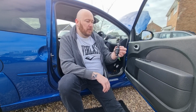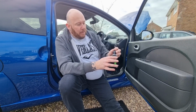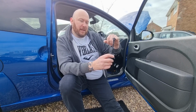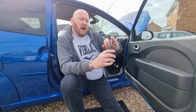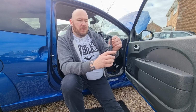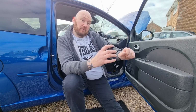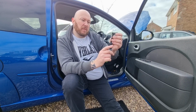This is the part, and it basically sits down there and attaches to your clutch pedal. The cage here, which has got a nipple, goes onto the actual pedal itself, and it then pushes it down like that. What's happening is these little clips here are not actually clipping on, and every so often it pops off and I lose clutch, and you just put it back on again. It's where they're worn out a little bit.